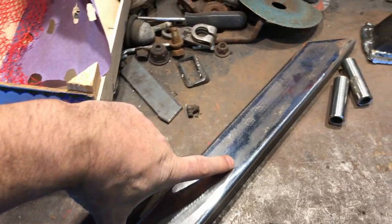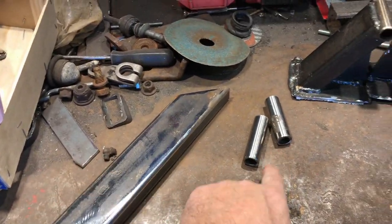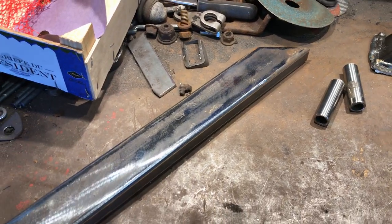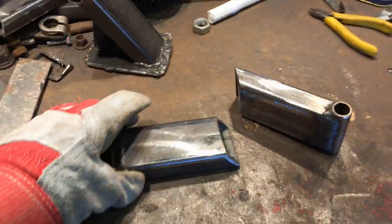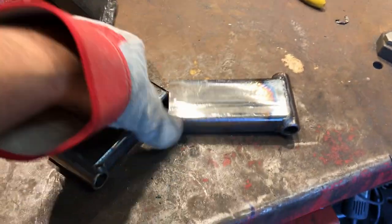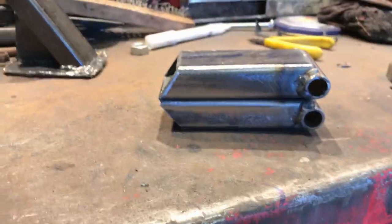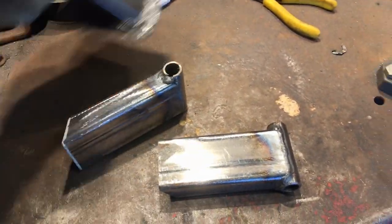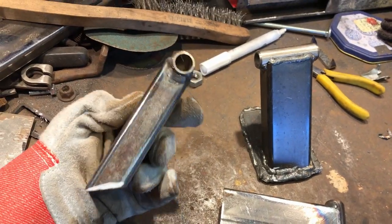So I just need to cut two lengths of this metal at the right angle, notch the tops, weld these in, and then put them on the motor, lower the motor in, and tack it in at the right place. If it's the right place, weld it in properly, add the gusset. Let's do it. Updated motor mounts are now made, and they are the same size this time. Right, so as I say, much simpler than the last ones, without the plate. Just need to add a gusset there once they're on the car. Right, let's go weld them on. Hopefully they work.